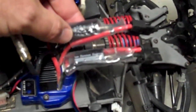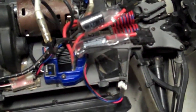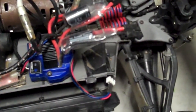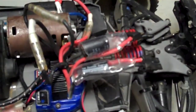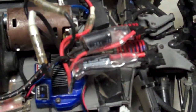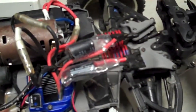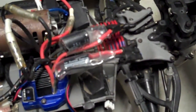These capacitors are 25 volt, 4700 microfarad, and they actually work quite well. You could probably get away with this setup on the eRevo. But if you were going to go to a high-end brushless system, I would recommend you do not run these capacitors — instead, build or buy a decent capacitor bank, simply because you're going to lower your ESR on the caps. On a high-end brushless system, don't do what I've done — not a good idea, I think you're going to be asking for trouble. Cheers.